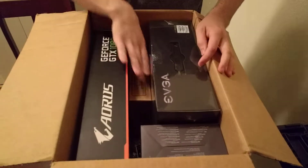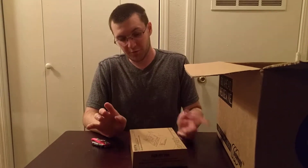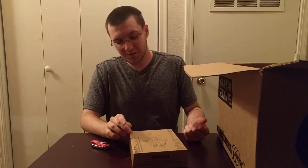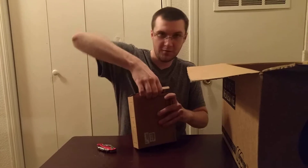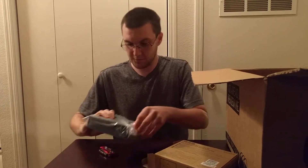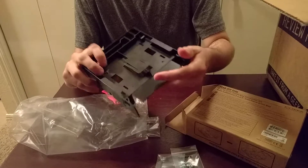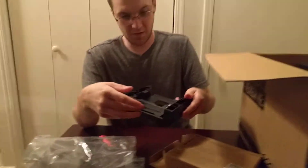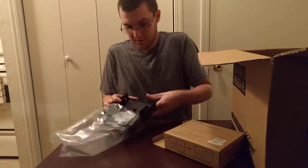Got a lot of stuff packed in here. I'm going to mostly do small to large. Since the new tower — the best airflow for it is if I remove the hard drive cage — it also has two optical drive cages. Since I do have a disc drive, I figured I'd repurpose the other drive cage to hold the disc drive. So I got an adapter which, based on the reviews, seems like it'll do the trick. It looks like solid states go right here, and then you can actually put a three-and-a-half inch drive here. Hopefully that'll work. I will have a build vlog so you'll actually be able to see if it works or not, and it'll be all unedited.